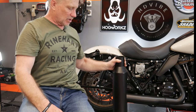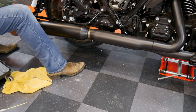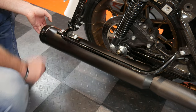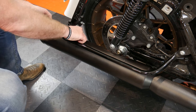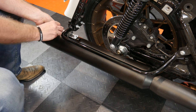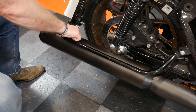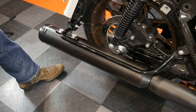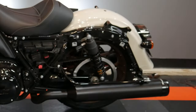Much better airflow to actually get the stage one performance we need, since we are getting more flow out the back of the bike. I've got it on there, so now gently move it into place. Slip a washer over that, then these are nylon lock nuts - get that started and do the same on the back one. Put some pressure on it to make sure it doesn't slide, pull the slip-on up, and once it catches those bolts they won't spin anymore. Now tighten up the rear half-inch bolts and the hose clamp, then repeat the process on the other side.